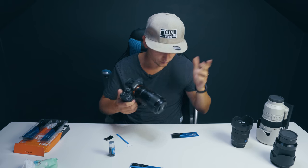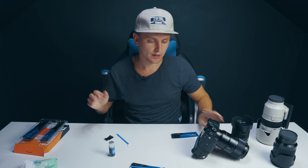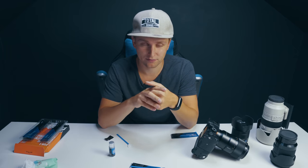The lens and sensor are now done. I know the sensor is clean and ready — no weird dust spots when taking photos or video. They also recommend doing this in a dust-free environment. If you can't create one, the best trick is to run a really hot shower in your bathroom for a few minutes, turn it off, and close the door. The steam captures dust particles and brings them to the floor, leaving the air clean. I'm just doing it in my office since I don't have a big bathroom.